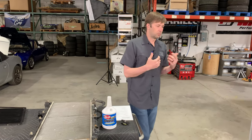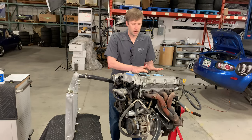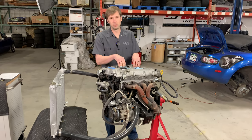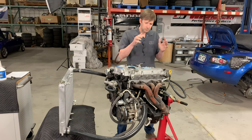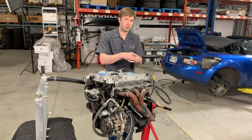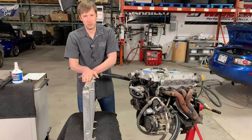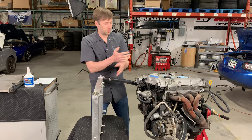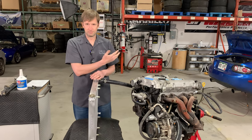Let's talk about theory and what a cooling system is. Your engine is basically a giant heater — it puts rotation out the back which spins the wheels, but a lot of the energy that goes into the engine comes out as heat. So you have your heat generator. What you need to do is get all that heat into the coolant, then take that heat in the coolant and transfer it to your heat exchanger, then take that heat from the coolant to the atmosphere. Gather the heat, transport the heat, shed the heat — that's the theory.